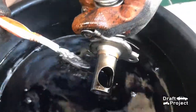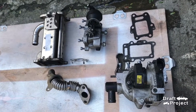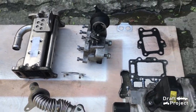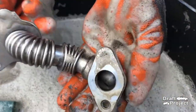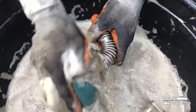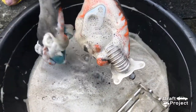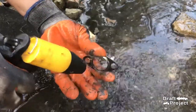This tube is connected to the EGR. I cleaned the EGR in another video — just click the link on the screen or check it in the description box below to watch that video. Now I am going to clean the tube with a degreaser. I use a sponge to agitate the solution. Clean the metal gasket too. Rinse everything and dry it properly.